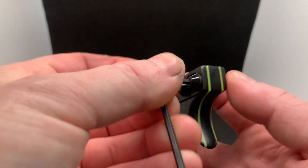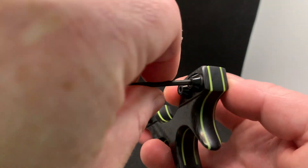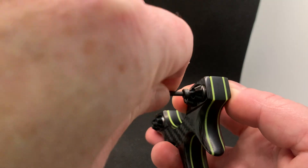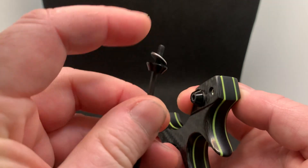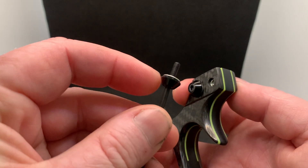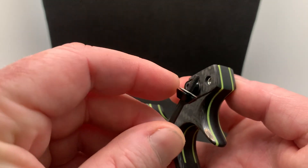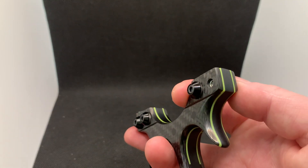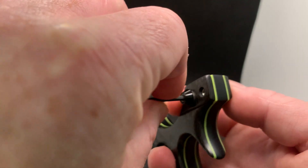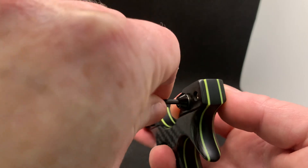So we're going to take this clip off. These bolts are M3 cap head bolts. We've got aluminium bolt cups and I put washers underneath because the aluminium cup pulls into the hole and it eventually damages the cup. So with a washer it adds strength — that is why we put those washers on there. You could probably get black washers, I've never really looked to be honest, they'd probably look a little bit better.